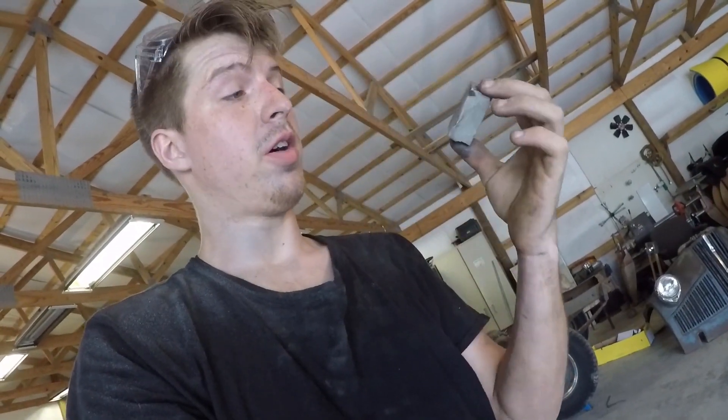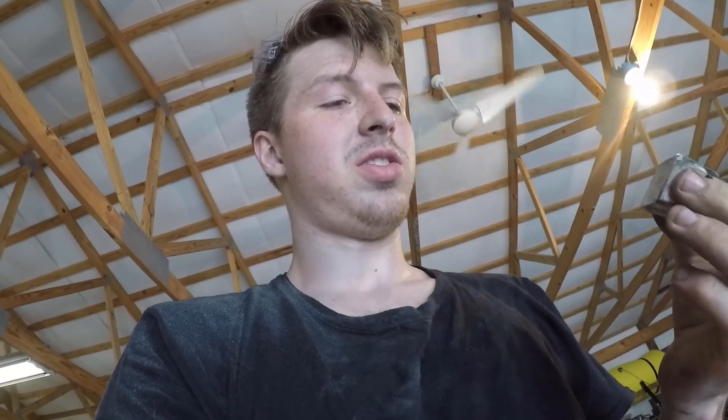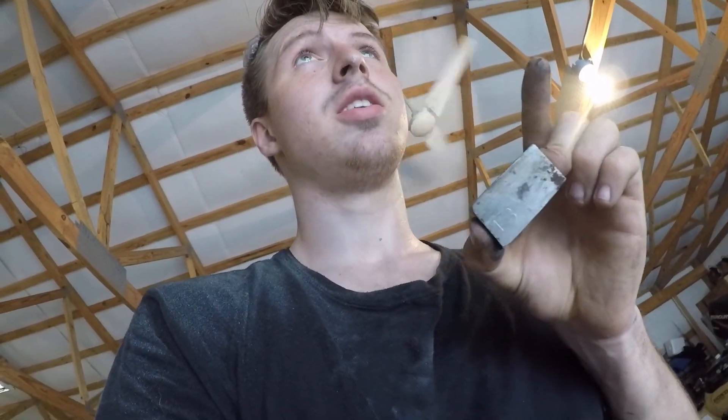It's important to mention: I just cut the chunk off and I'm keeping it. This is very important — I didn't do this on my last engine and it was a huge headache. This plate tells you the bearing grades of the Honda OEM bearings, and you need to know this if you ever have to rebuild. Keep it just in case — it's really recommended, don't throw it away.